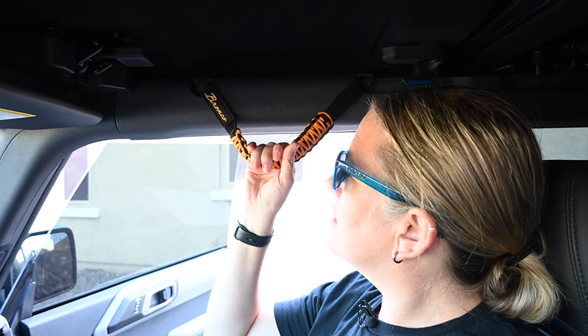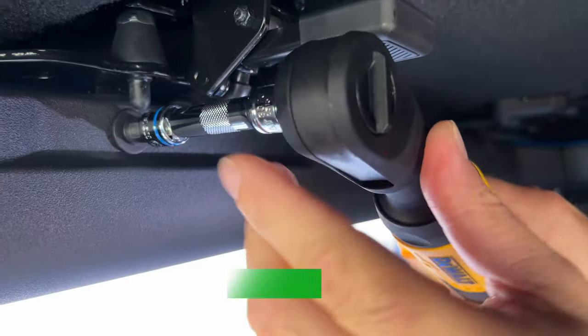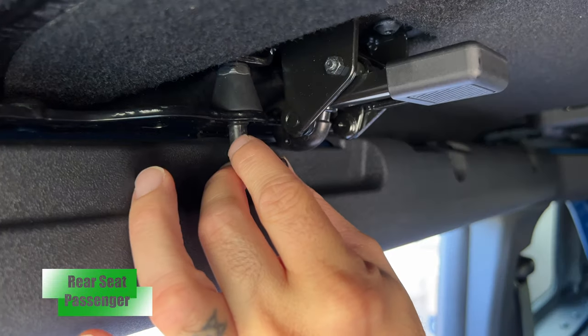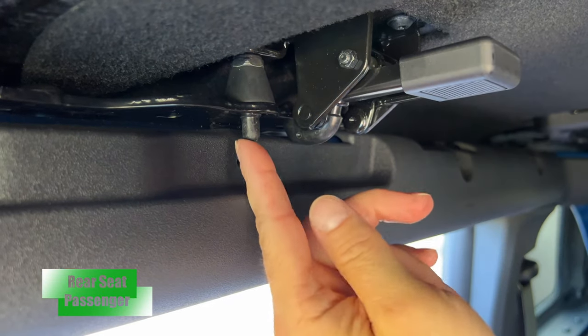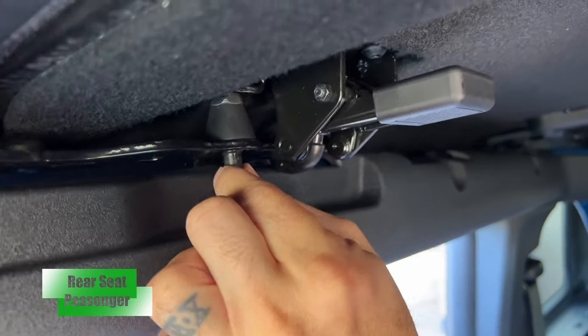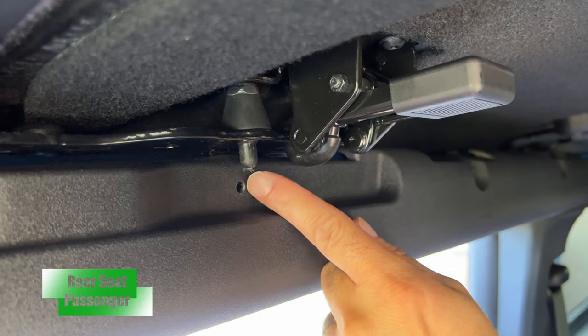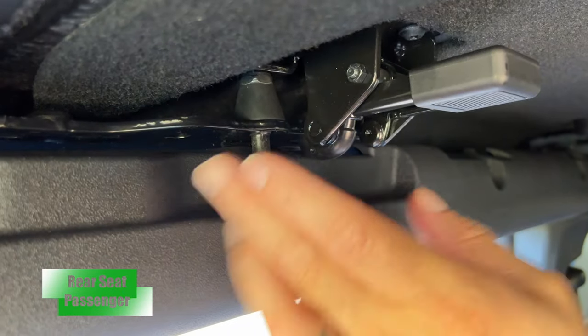Let's see how they hold up — let's put the rest in, get them in the rest of the car. A little Bronco Easter egg here for you: I'm going to show you kind of a weird design. That washer comes out and hits this plastic locating pin for the roof panel. It doesn't hurt it — it will shave a little bit of plastic off as it comes out because it can't clear, but don't worry if that happens.